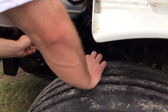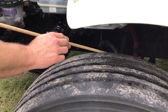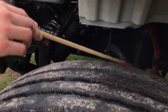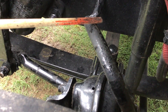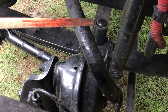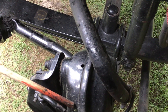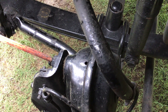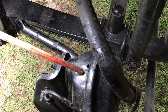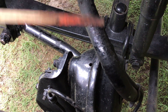From there, we'll work our way out. We have our brake lines. My brake line is properly mounted and secured. All hose clamps and fittings are present and tight. It has no abrasions, bulges, or cuts, and it's not leaking. My ABS wire is properly mounted and secured — it's not cut or spliced. My brake chamber is properly mounted and secured. All nuts and bolts are present and tight. It's not cracked, bent, or broken, and it's not leaking. My air hoses are also not leaking.